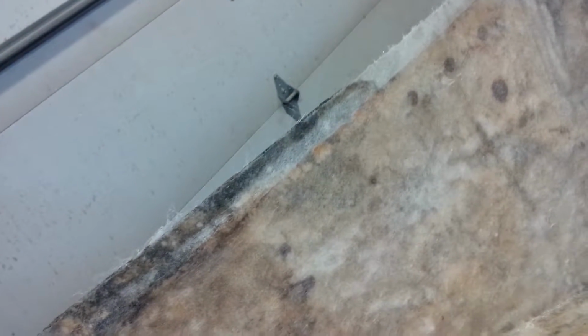I just wanted to build it up a little thicker, like I had mentioned. I sanded it quite a bit, and I was worried there might be some low spots, so I figured throw a sheet of fiberglass on there just to be on the safe side. I overlapped all the way around by probably 3 inches, as you can see, just to kind of tie it into the rest of the boat.